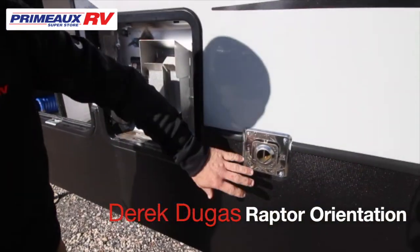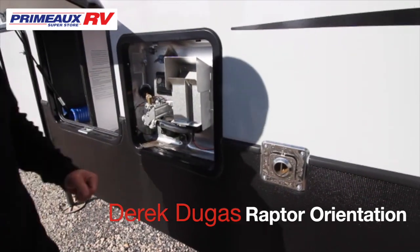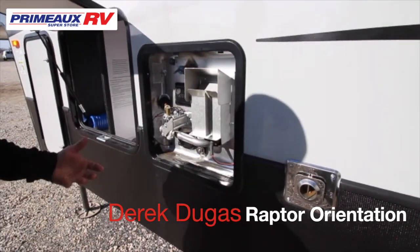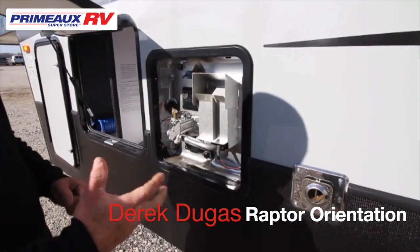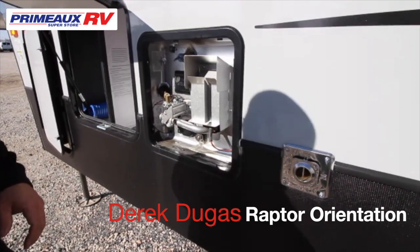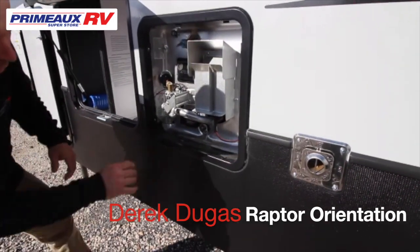Here next to your hot water heater, this is the exhaust for your furnace. So when you're running your heater in the winter time, this is gonna get really hot. Make sure nothing's in front of it. Also, kids like to warm up in front of it. That's carbon monoxide, so don't let them breathe that. That's not too good for them.